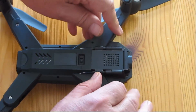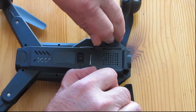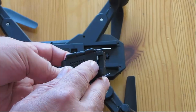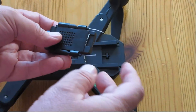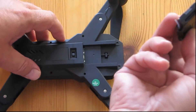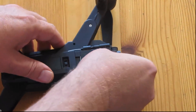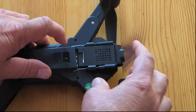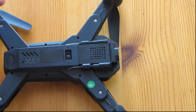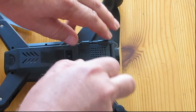You put your fingernail under both sides of these antenna support knobs right here and push forward, and you'll notice that the camera pops out. It's a modular camera, and there's the microSD card slot. You just plug your microSD card in there, and then you can record in HD. After putting your card in, move the antennas out of the way, and you can easily slide the camera back into place and plug it back in. So it does have a microSD card slot — it's just hidden.